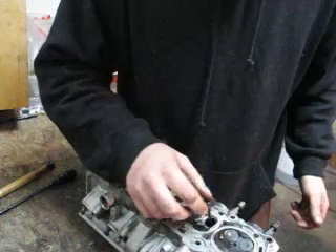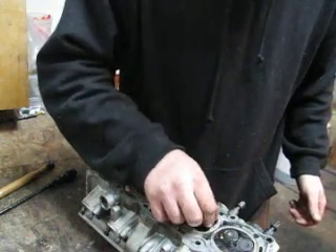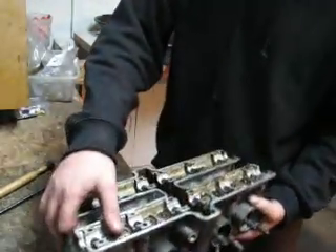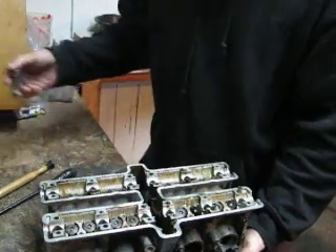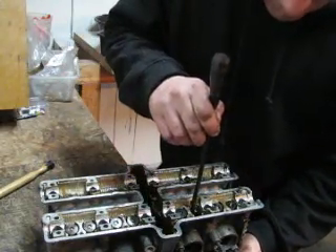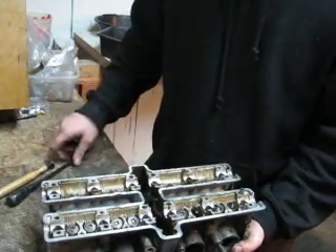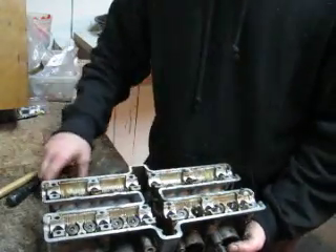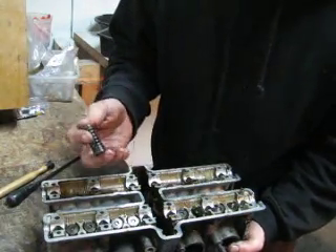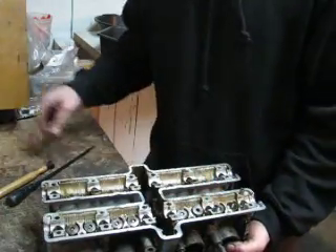This one's been lapped. Look inside to make sure the washer didn't come out. A lot of heads have a washer in the bottom that the spring seats against, so that the spring doesn't push against the aluminum in the casting. Drop the spring back in — that washer's still there.